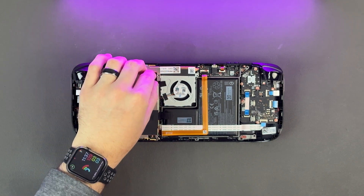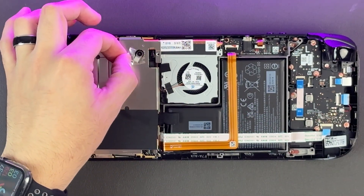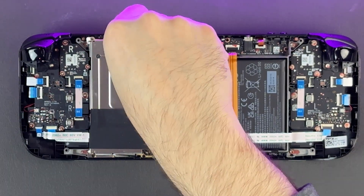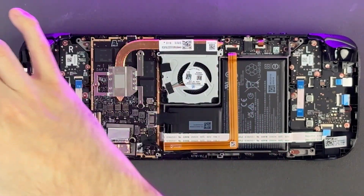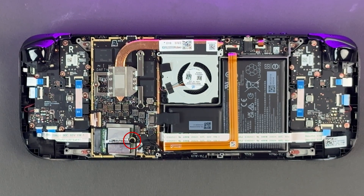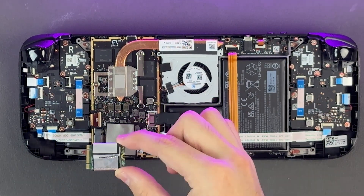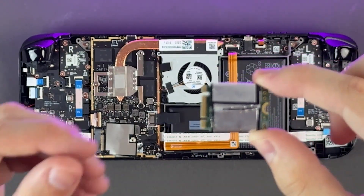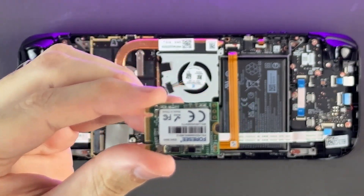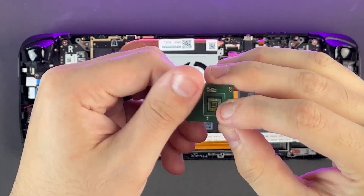To continue, we need to remove the metal shield. There is a small screw hidden underneath the foil, so you can just peel it back and unscrew the following 3 screws. These are not the same size — the middle one is shorter, and the outside two are slightly longer. Once unscrewed, you can freely pull up and away to remove the shielding. In the bottom left, that is our current storage device that we are looking to replace. Unscrew the single small screw holding it down, then gently pull the drive out with a little wiggle out of its socket at an angle. Even though you are replacing it, I recommend holding onto it in case you ever need a backup. The storage drive should be covered in an ESD casing — gently peel it off and hold onto it as we are going to reuse it.